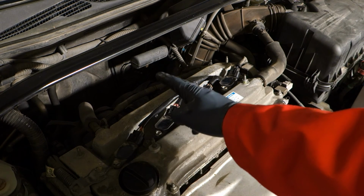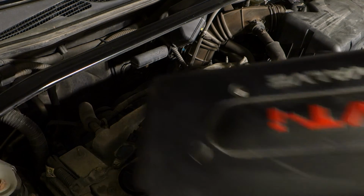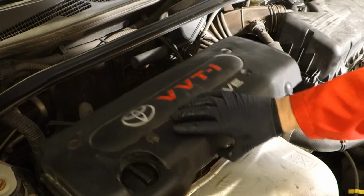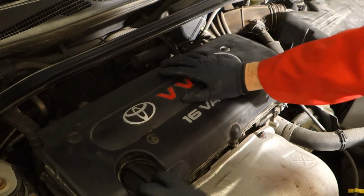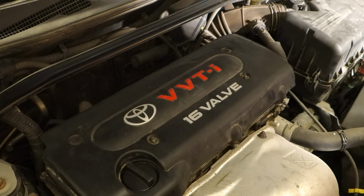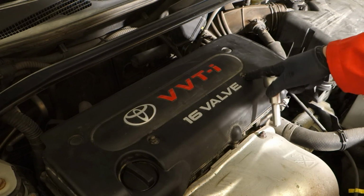and then I replaced the second, and then the third, and then the fourth in the same way, and then the spark plugs are replaced. Okay, and the final step is to install this cover back, and the cover installation happens so that there is this hole, and that bolt goes in that way in here, and in that area a little bit of movement, and now it's fine. And then we have these 10 millimeter bolts that we need to fasten in here, and also these, not too much force, and also in here, and then this job is done.